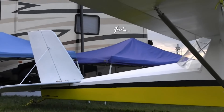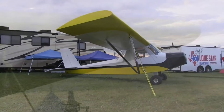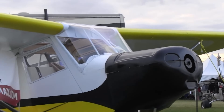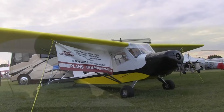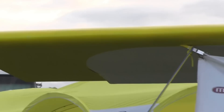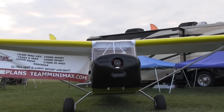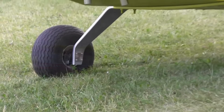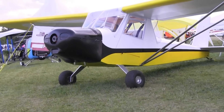The Minimax line of aircraft made its first appearance back in 1984. Primarily constructed from timber with plywood reinforcements, these planes are covered in fabric sealed using varnish. Most versions come with a windshield but no enclosed cockpit. The wings typically span 8 meters, though earlier editions came in at 7.6 meters. Both the wings and tailplane are braced with support struts, and the only shock absorption comes from the tire pressure.